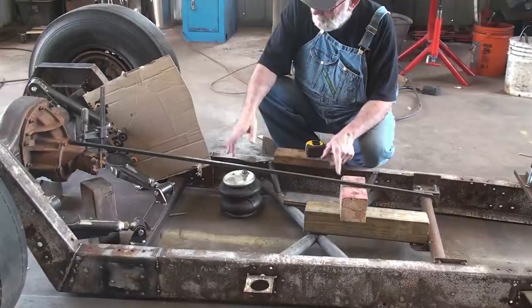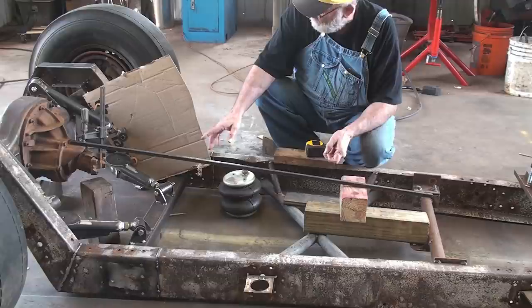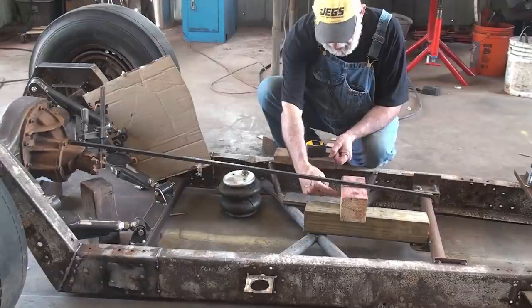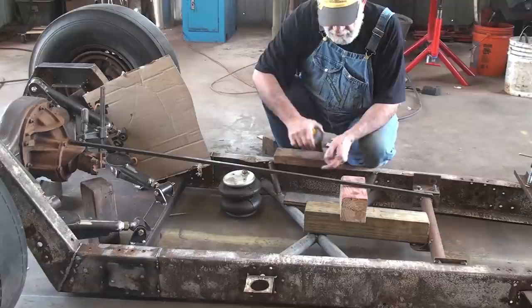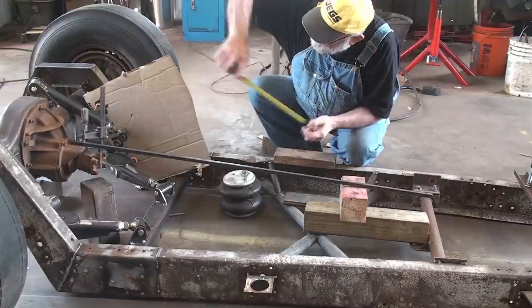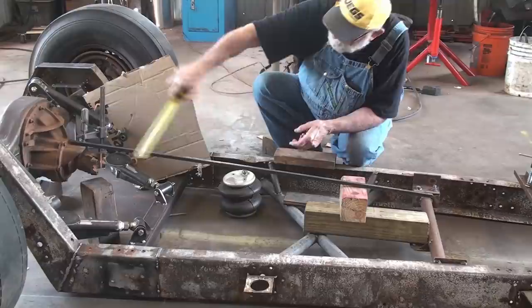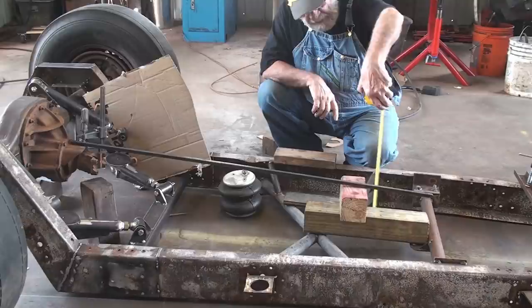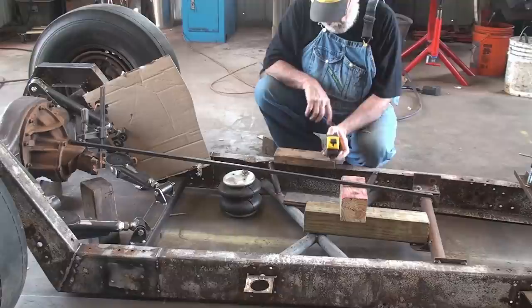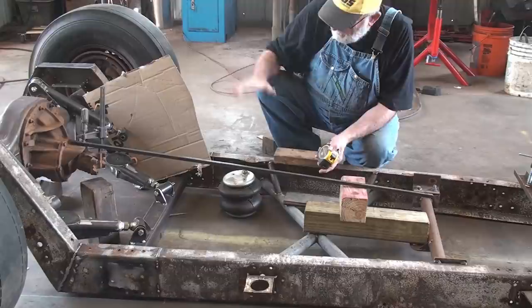This is the most important part about setting up your rear end in a rat rod. Whether you're setting up a triangulated or parallel four-link, you need the rear end pointing at the tail shaft of the transmission. I measured the transmission: it's 5 inches from there to the center of the shaft and 10 inches from there to the back of it. Then I have to add 3 inches because this point here is up 3 inches from the center of the driveshaft — so 5 plus 3 is 8 inches. I measured and got about 7, which is close enough for a rat rod. So this rod is representing the driveshaft, and if it's sitting on top right there, that means the rear end is pointing at the tail shaft of the transmission, which is what we want.